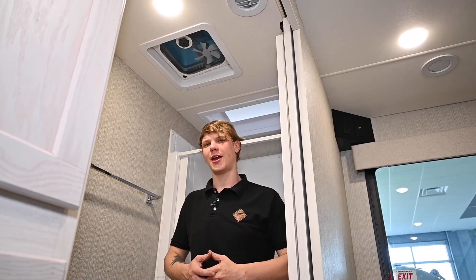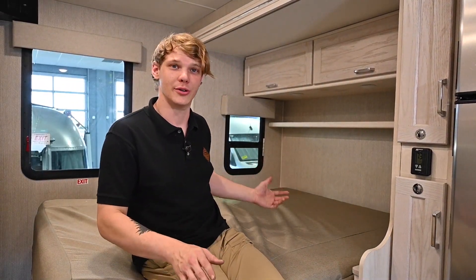Maybe not in this unit, but in something larger like a Class A. If you're in a high humidity area, a portable dehumidifier can be very beneficial. Be on the lookout for signs of moisture — water droplets on walls or windows, wet carpets — anything like that is an indication that there's a leak. And if there's a leak or condensation, we want to nip that in the bud before it leads to mold. Mold leads to asthma and other respiratory issues. Avoid drastic changes in temperature in your RV — cranking up the AC and then opening doors or windows is a surefire way to invite condensation into your unit. It might look cool to see your breath inside your RV, but it's not so cool when that condensation turns into mold.